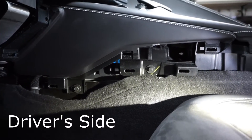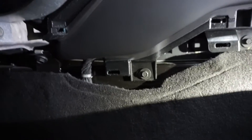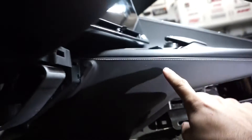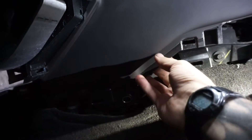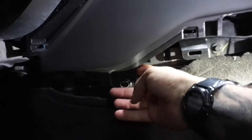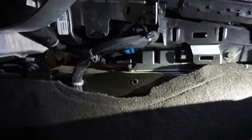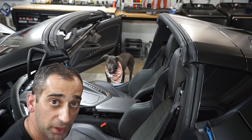To get the side panel off, there are panels on both sides that expose bolts to get to the center console. On the driver's side you have one 10 millimeter bolt right there — go ahead and take that out. Once that's out, there are some clips and hooks on the top that hold it in. Pull from the bottom, gently but firmly — it's going to feel weird but it will come. Then you'll see there are hooks on top too. Once that panel is out, you have four 10 millimeter bolts: one, two, three, and a fourth bolt in the back.